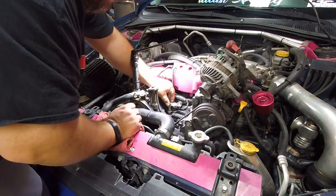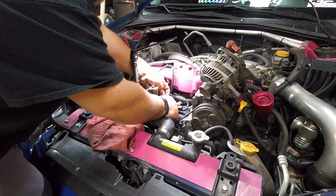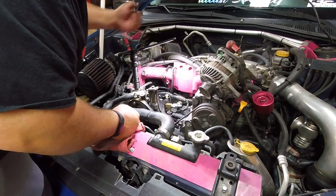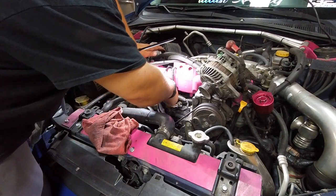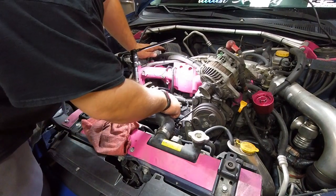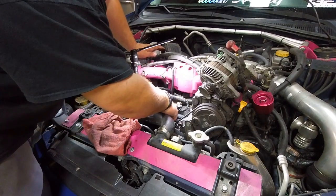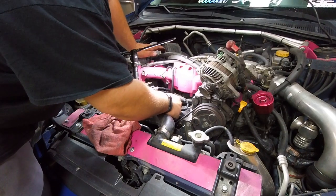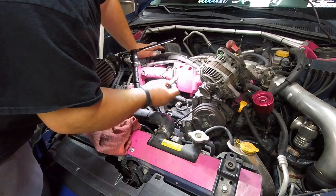I don't believe I have room to go to the side like this. Even if I did, the switch wouldn't fit on this other side. So that's not going to work. I can definitely see that I'm going to have to take the sensor back out and screw the fitting and the T in first, get those where they need to be, and then try to get the sensor and the switch put back in it from there.